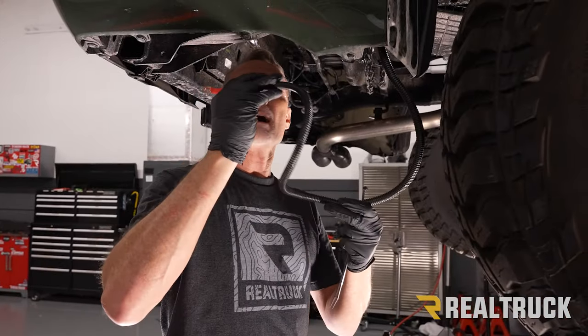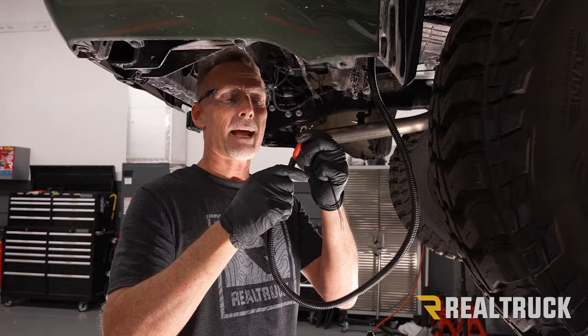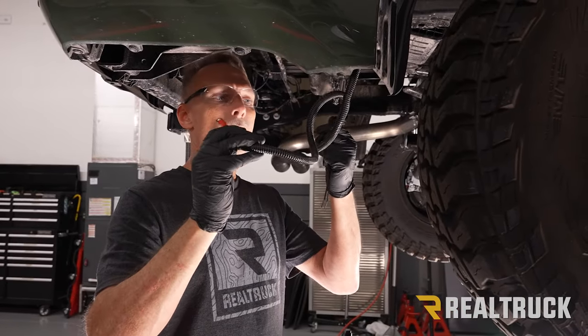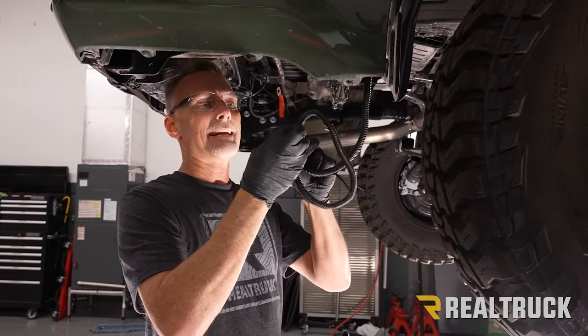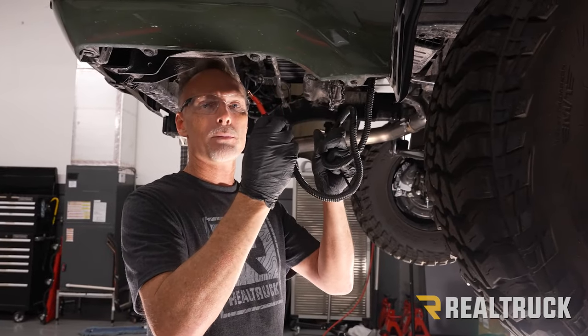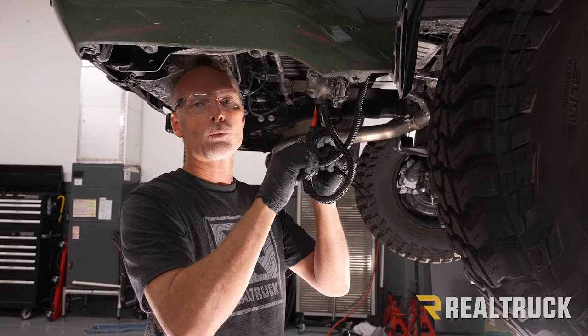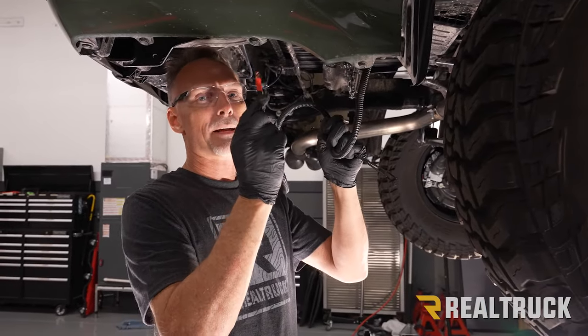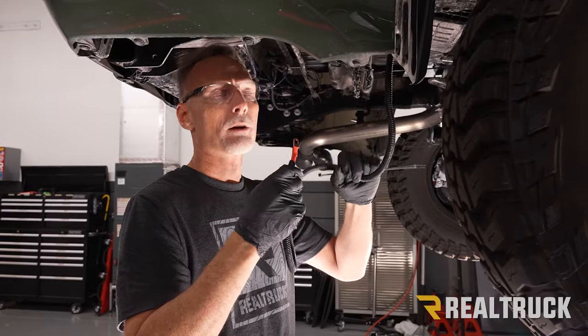Okay, so here is our positive wire. I've already gone ahead and attached the end. Now, I always like to keep a little extra wire that I can coil up in case I need to cut this end down a little bit. I've got plenty to use, or I can pull it back towards the battery again. So this is just going to get coiled out of the way, and this will be attached to the positive end of our bus bar.